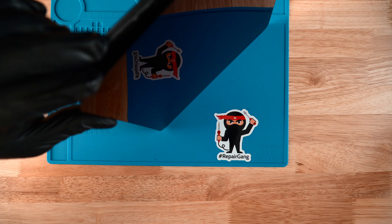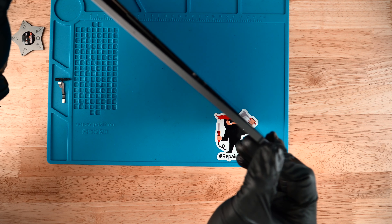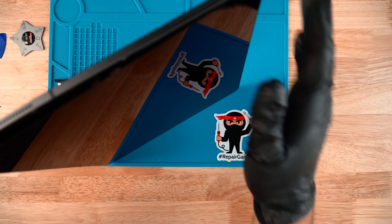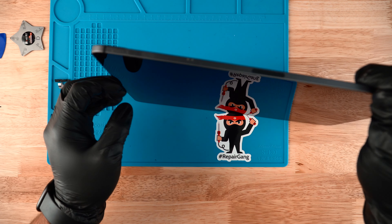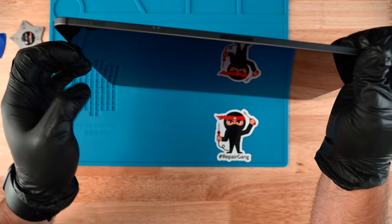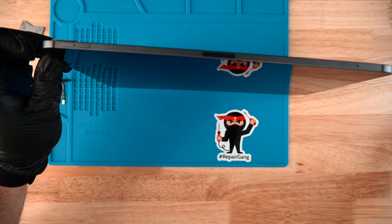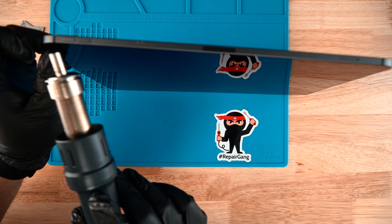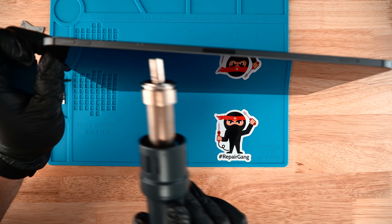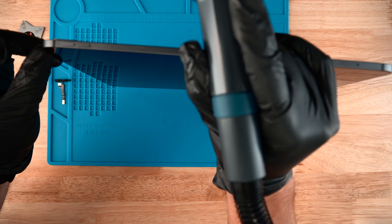You want to keep going until you at least get it to peel open up to the bottom corner. Once you do that, go ahead and start working on the other side where you have the volume up and down button. Just try to get your fingernails or fingers in there and pry the screen lightly up from the housing while applying some heat. Make sure you're going back and forth so you're not directing heat into one place.